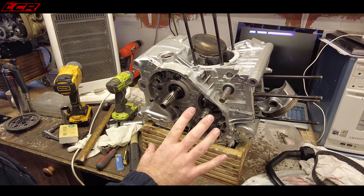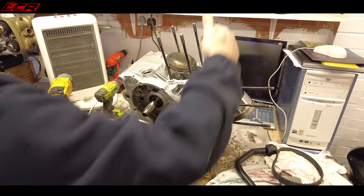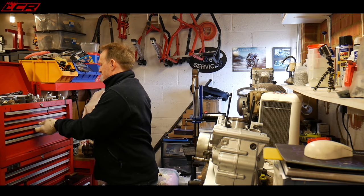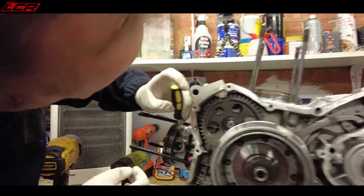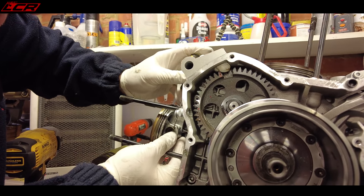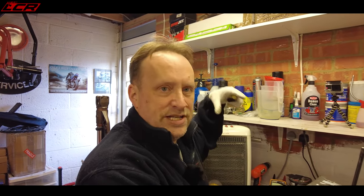This side is completely ready to split. Although we've still got the keys and the retaining clip in the intermediate shaft, we'll release it fully on the other side so the cases can still split off. Now we'll take the pistons off because they're easily accessible — it's just a case of pulling out the circlips with a circlip pliers. Just lift it out.